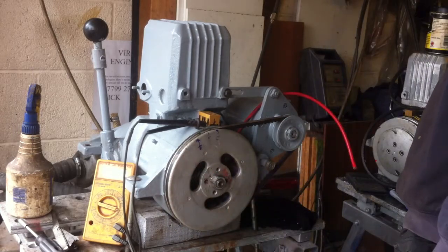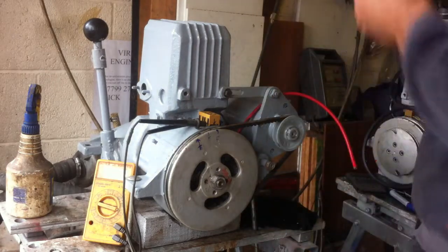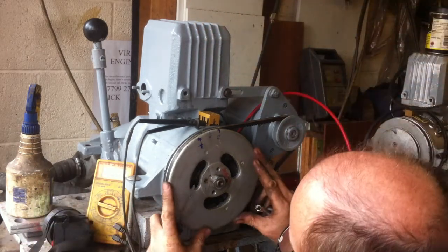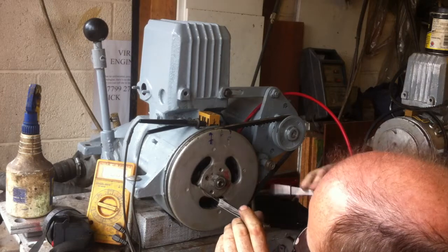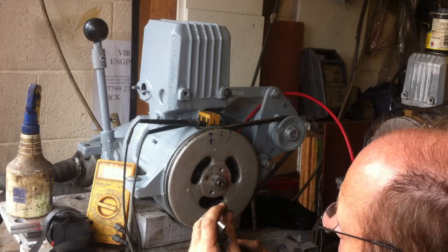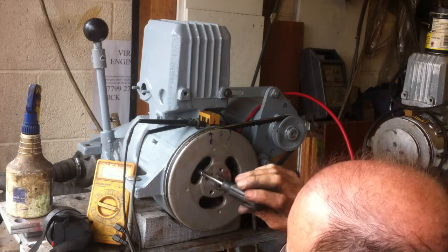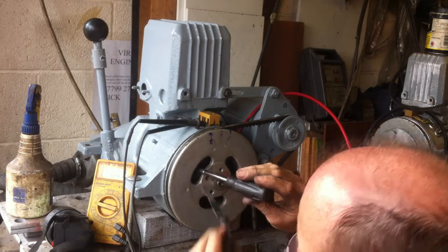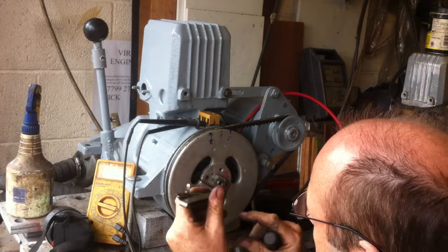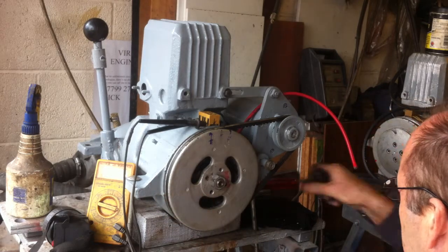Next job is to adjust your points gap. A good pair of spectacles, a 17 thou gauge, and a little light in here. Rotate the points around until you can see them just opening, and adjust them so that your 17 thou feeler gauge fits in. You want a nice straight tip, not a bent one — you don't want to damage the screw. Loosen it a bit, adjust the gap so that 17 thou slips in between, then tighten it up, not so much you can't undo it in future. Double-check the gap, then put a piece of paper through the points to clean any dust off. That's the points gap set to 17 thou.